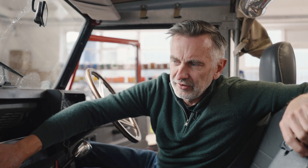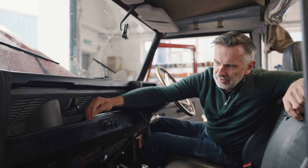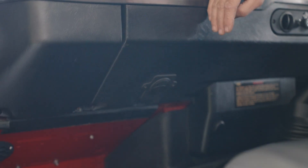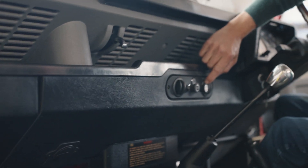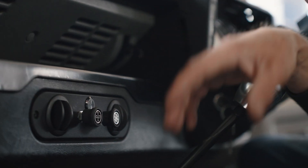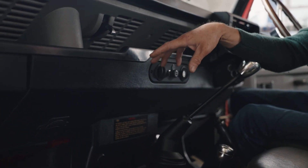What you can't see is that inside this dashboard area we've produced a system of parts which divides the space into smaller compartments. The air comes into a sectioned-off compartment here, then a duct brings it up to the two centre vents, and another brings it right across to this footwell vent on this side. This basically means the only areas actually getting air are a section here at the vents and a section here, which should go some way to combating the condensation problem.